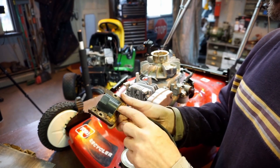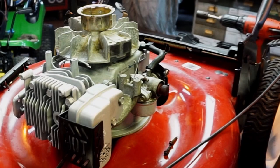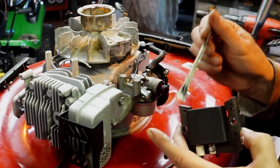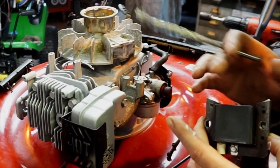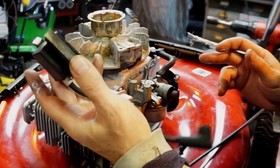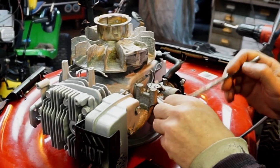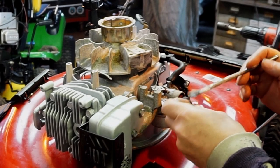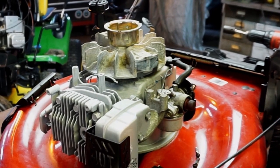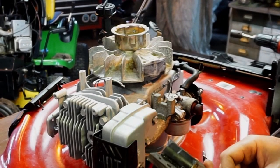See — the grounds are getting beat up too; we want to get that cleaned off. Always peek in there — this one's good, but always look. Now just to sweeten everything up, put a little white grease on it to keep them from rusting right away. That's optional. I clean these in an oil bath in my solvent, make sure they're nice and clean after I wire-wheel them. More important is getting some grease or oil on these threads — we want to make sure this gets tight. We want to feel these threads because we don't want to strip that.